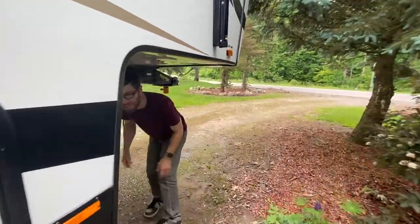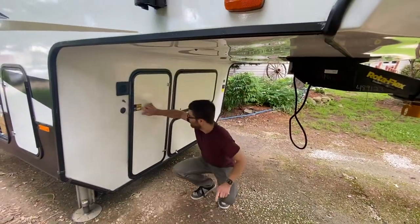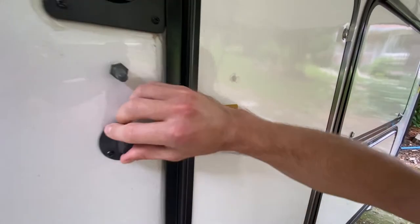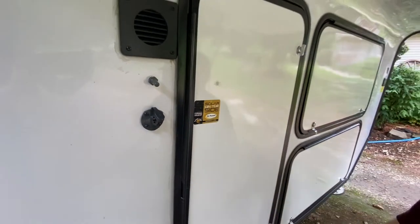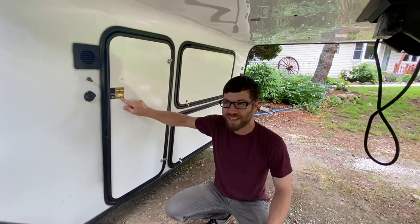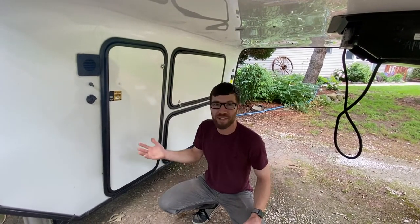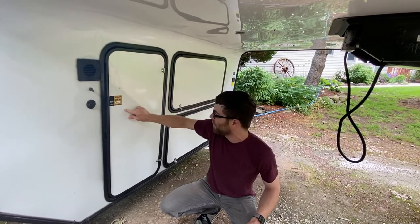If you come around here, this is my department for all the electrical stuff. Mini rant here — if you see this "solar on the side" thing, they try to tell you that it's basically solar ready. What I've learned is they literally wire two pins to the battery, and that is all they do. There's literally nothing related to solar — no charge controller. They just give you a connection to the battery, and you're required to buy a separate charge controller that goes in line with your solar panel. It can be a very expensive way to go, so don't think this is going to be the end-all be-all for your solar setup.